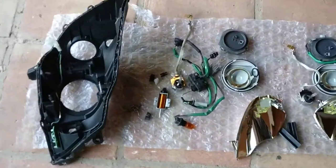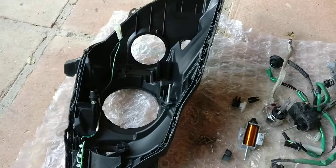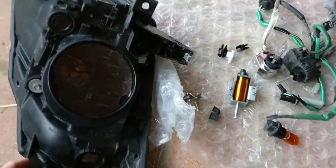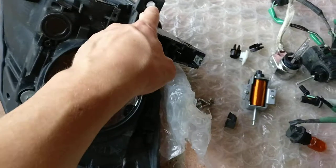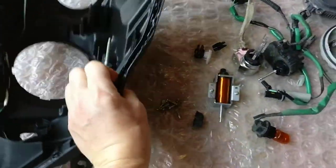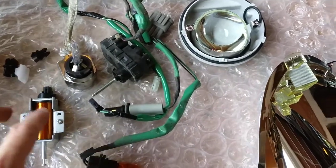To get those out of the headlights — this is what is left of the headlight, there's a bit more inside — you have to take the bumper off to get the whole headlight assembly out. It's secured with four screws, I believe — a combination of some of these and maybe some around here. And you have to remove all the wiring. You can't get this off until it's out.